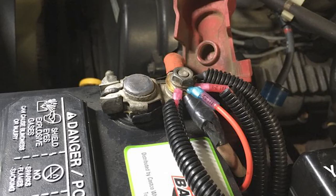Now prior to putting in the Blue Sea system I was actually using the factory battery terminal post and everything was fine until I had too many accessories. You can see in this picture here how many threads I had left on that post. So I decided I was going to upgrade the electrical system and put my own fuse block in and also put a circuit breaker in. It was only going to cost me maybe $100 or a little bit more, and I figured in case I want to add more things like my refrigerator, it would make things a lot easier with the fuse block.